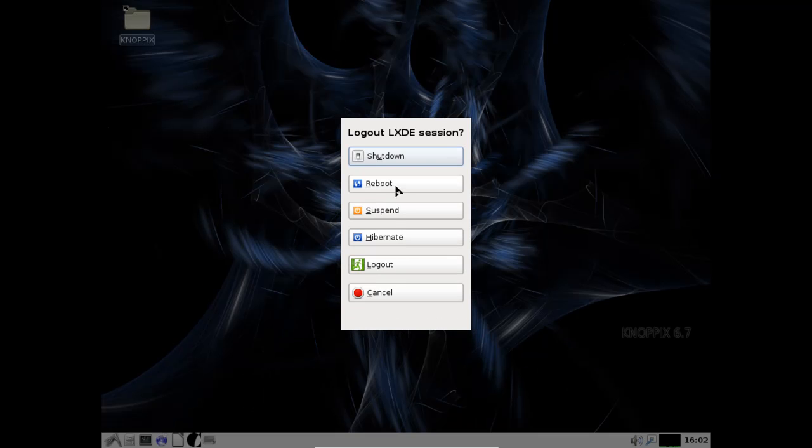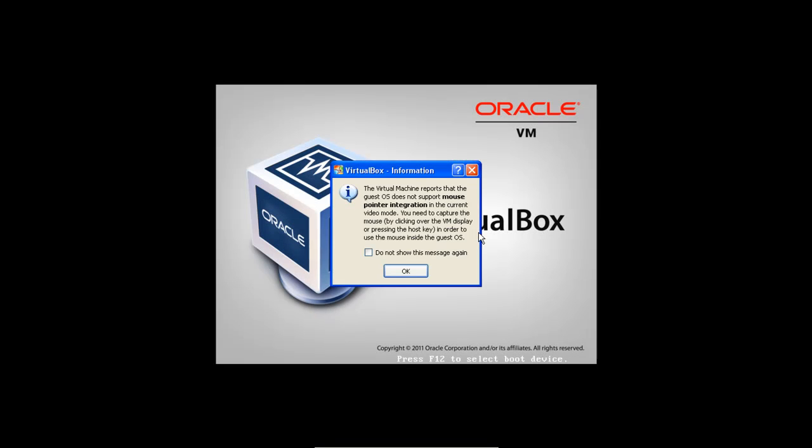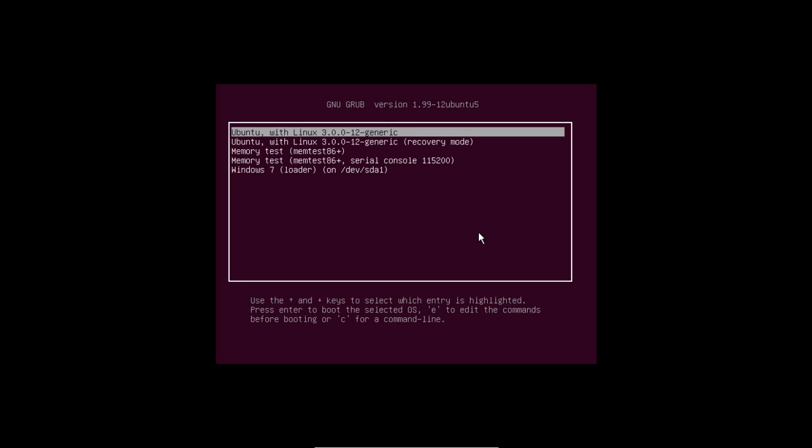Just to make sure we can see that, we'll go ahead and reboot the machine and pretend that our version of Windows 7 has been fixed. We'll look at our external storage to make sure those files are there. If you're doing this as a practice, before you actually reformat anything or rebuild your machine from the ground up, you might want to take that external storage to another computer to verify that data works before you wipe. That's just a good practice. You'll be prompted to remove the CD from the tray — hit Enter once done, the machine will reboot. This is an Ubuntu 11.10 and Windows 7 dual boot machine, so we go into GRUB and select Windows 7.